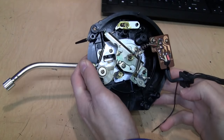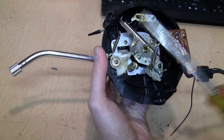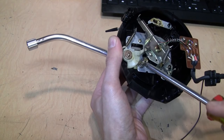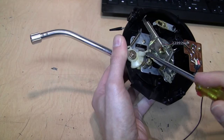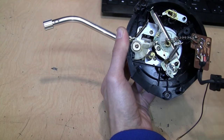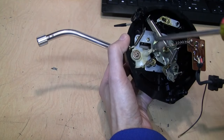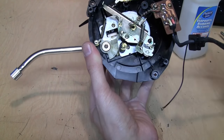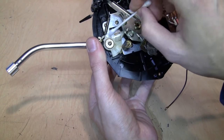Here's the underside of the tonearm assembly, and this part is our culprit. When you push it up it should spring back — that's what lowers the tonearm onto the record when you let it return under spring tension via the movement of this arm. But the problem is old grease that has become sticky. Get out your cotton swabs, soak them in alcohol, and clean up all the old grease around this arm.